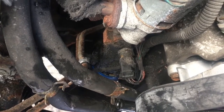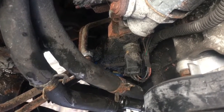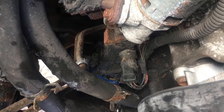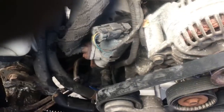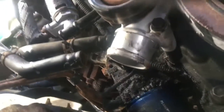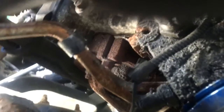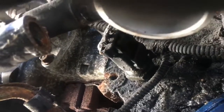I'm going to have to climb underneath to remove the clip that holds the wire plug on there. Here's the view from underneath — that would be where the lower radiator hose comes out of the water pump, and there's your oil filter. Right above the oil filter is the switch. You probably can't see the clip because it's all covered with old oil and grime, but that's what I need to push down on to get the clip off the oil pressure switch.